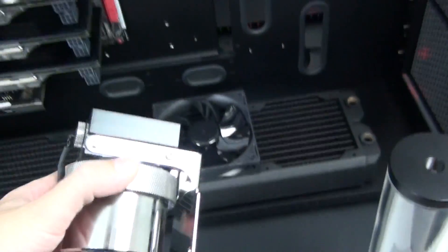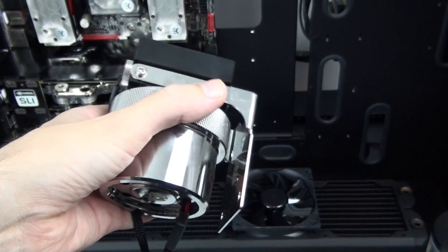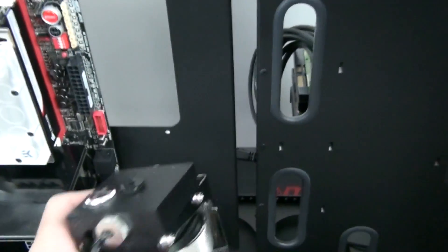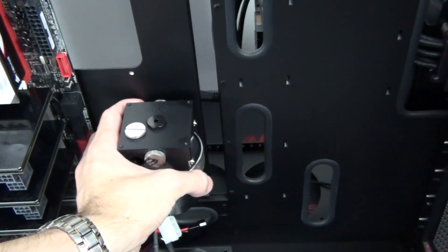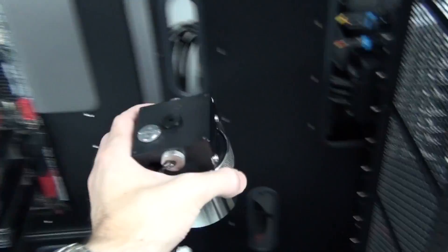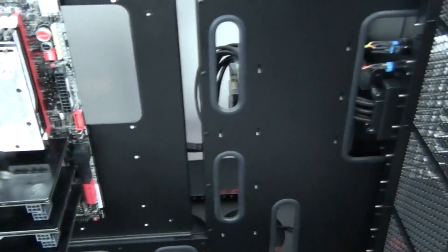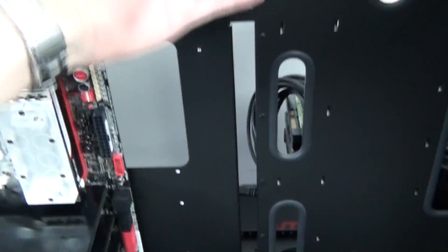You might be thinking: why didn't I go for the ATX motherboard tray? That's because there's no ATX motherboard tray option for this case — this is the only motherboard tray option and it accommodates all of the different form factors. The big hole next to the 24-pin is there because I've removed the cover off the back of the motherboard tray, and there's no way I'm using that for cable routing because it looks terrible. So basically cable routing is a problem. The other problem is the pump and res configs — there's no good flat surface to mount them onto, and I want the background behind them to be clean, not full of holes and panels at different levels.